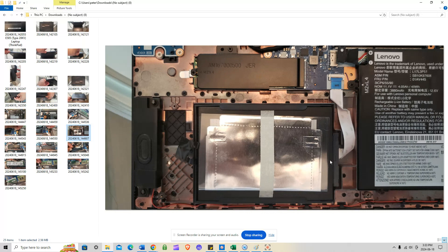You can unplug the battery or not — it's optional. If you're the careful or paranoid type, you may want to disconnect it for an M.2 swap, memory upgrade, or especially a screen replacement. If you're not accurate at placing the 30 or 40-pin LCD cables, I'd highly recommend unplugging the battery first. If you push the LCD cable in at an off angle — not going in evenly from left to right — and it hits the socket pins improperly, you can short your motherboard and lose the system.